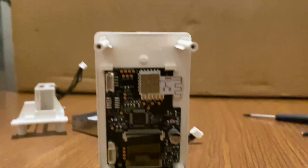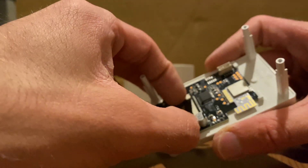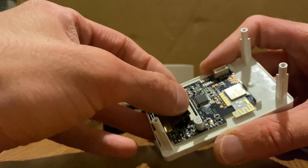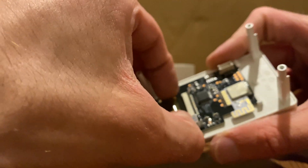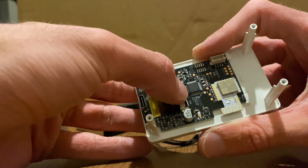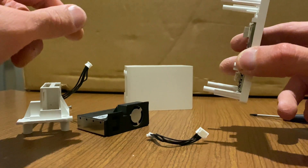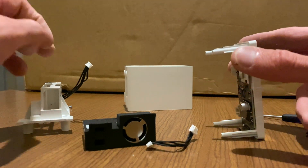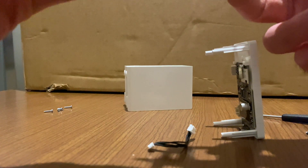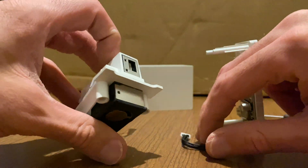So this cute little board seems open to quite a bit of modding. Sadly it's not cheap — this is 35 euros. If you just want HomeKit compatibility it's still cheaper to get the Vindrichtning and add an ESP32 Wi-Fi module or ESP8266, which is like a 3 euro module and a 10 euro sensor — far cheaper than this. But with this you gain the display and it should work far better. I've seen it in the shop and it looked far more precise, updating in real time.